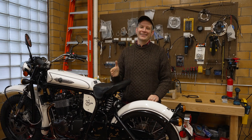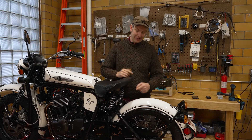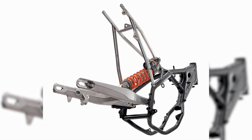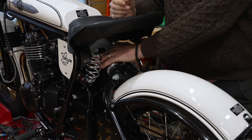However, in recent years, leading off-road bikes — oddly enough, like KTM — are moving back to a direct suspension. By direct, I mean the shock absorber is connected from the rear suspension unit straight to the frame, just like on the 250 Softails and older bikes, partly because of advances in metallurgy and engineering and what a shock absorber can now do.